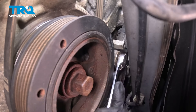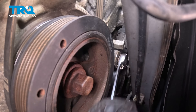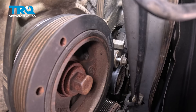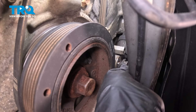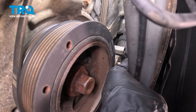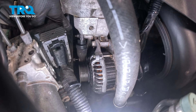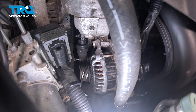This will not be able to be removed yet. Once it's loose enough, you should be able to unthread it by hand. It's out of the threads and up against the frame rail — perfect fitment. Now, from the top, you'll see a 12mm mounting nut right there. That's what we have to remove in order to free up the tensioner.